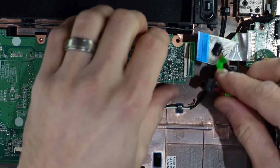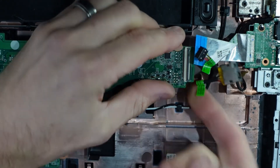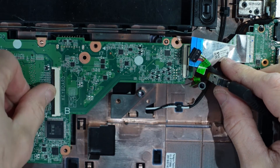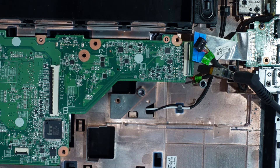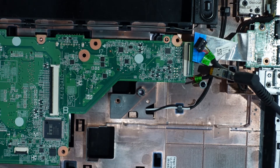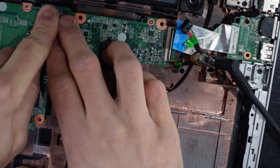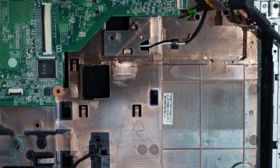I've got my hands on another DC jack. It's nowhere near as big as I was wanting, but for troubleshooting purposes it will be fine. I reconnect it in there and connect up the power. As you can see, we have no charge light — that's not looking promising. I'll close the lid slightly, put the battery back in. Still no light to charge. So right now I believe this one has had a mainboard failure, and there's probably not much point in proceeding much further on this particular machine.